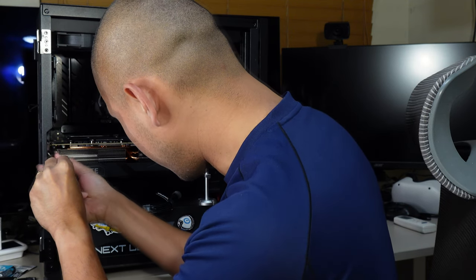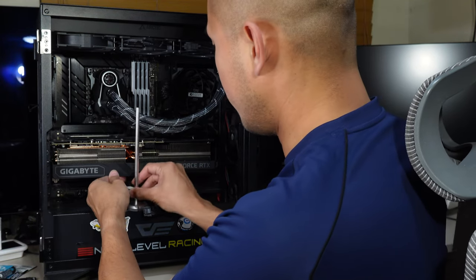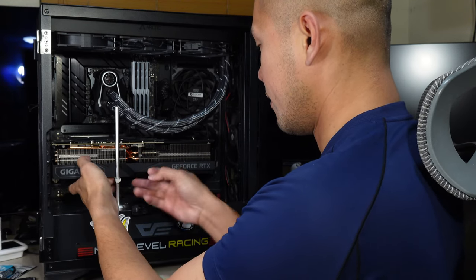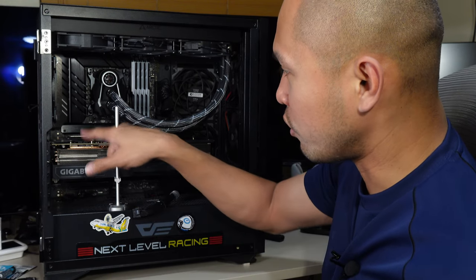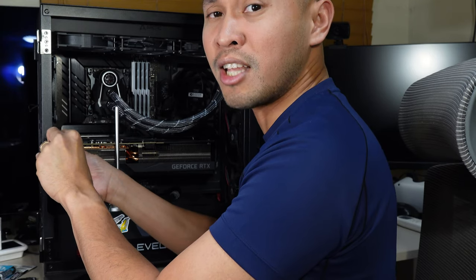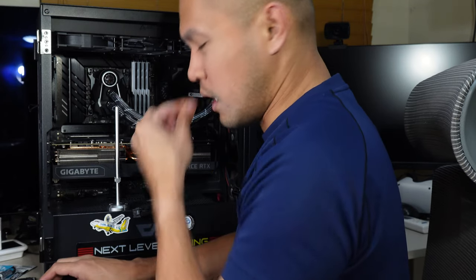The video card is really heavy on this side, so I just moved my GPU stand here to support the video card better, because it's weighing the PCIe slot down. I really don't want to put stress onto the PCIe slot, even though the motherboard says it's highly durable — I don't want to risk it.